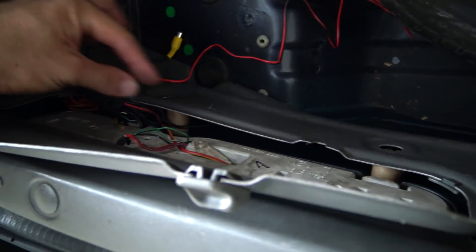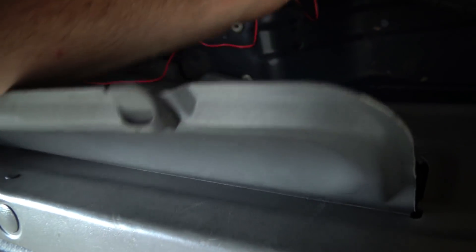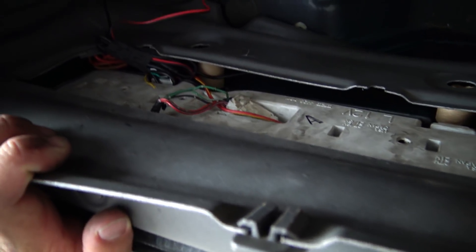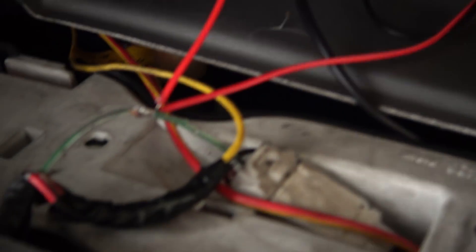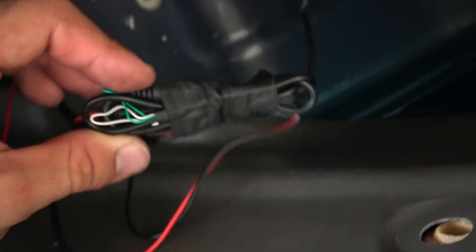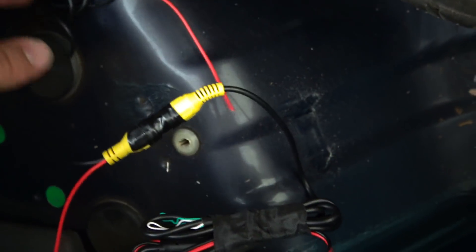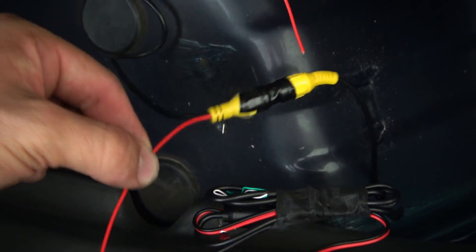Same deal — I'm going to cut it to length, put the ring terminal on it and mount it. Some people use the whole wire length and then they've got it all shoved in the back there. I mean it's still going to work, it's just going to look bad. So let's solder our wires on. The two wires we've soldered on are the red wire from the camera's harness and the red wire from the RCA harness that we're running up to the front, so the head unit knows to turn on. One thing I've got to stress is tape your RCAs together — this is a moving vehicle that vibrates, not your TV.